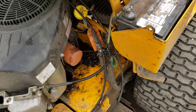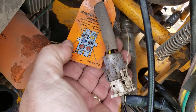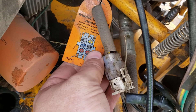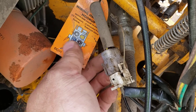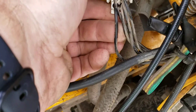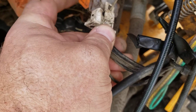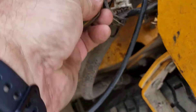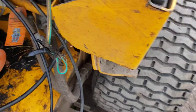Over here on the electrical system, we've got a couple of connections. The bottom red ones are for the 12-volt battery. Then we've got the engine kill switch, oil pressure switch, and the carburetor fuel solenoid valve. On that connector, you can see all the wires connected up. I got a little connector that I made up, and those wires connect into this bundle right here — three wires that I brought to the other side of the unit.